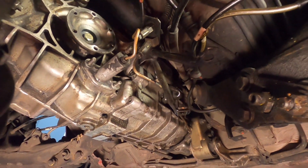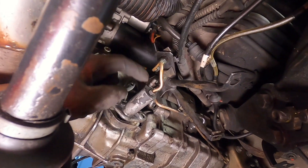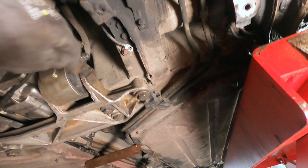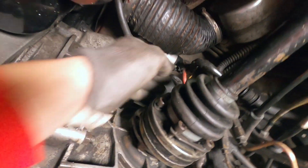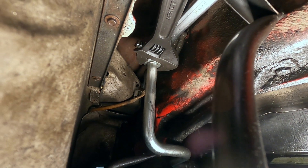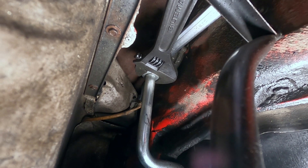We have released the cylinder, so I can actually pull this one out now — this one is loose. We've released the bracket here, which holds both of these two actuators: the one that goes in this direction and the one that goes in this direction. Important not to miss here is the earth braid that sits over here, and there's another one here just on the starter that we're going to release up in the chassis. Then you have the 12 volt cable connection here to the starter. Something that cannot be forgotten is to release the return line up to the filter — it's very difficult to do without pinching your hands, so just brace yourself.